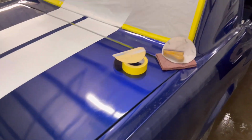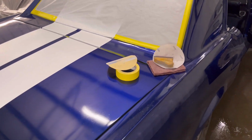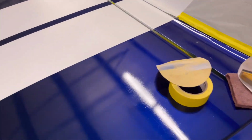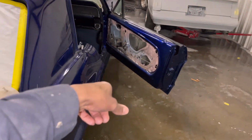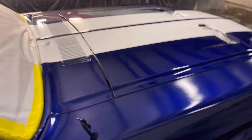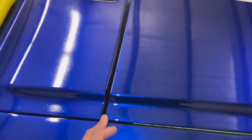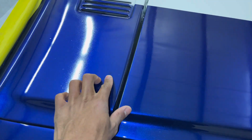And then I think we'll go ahead and, I don't know. That's the thing. I don't want to put no paint on top of the clear if I don't have to. So we'll sand the whole thing with 600, fix that area. And then, lightly, I probably won't even do a drop coat. I think it's some minor imperfections in certain areas. It looks a little dark. Why does it look dark on camera?